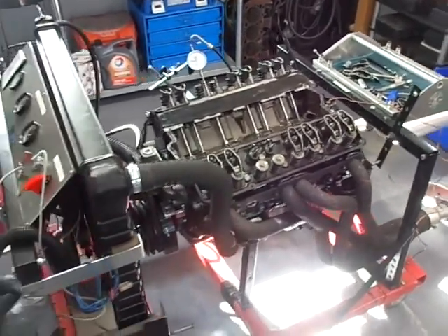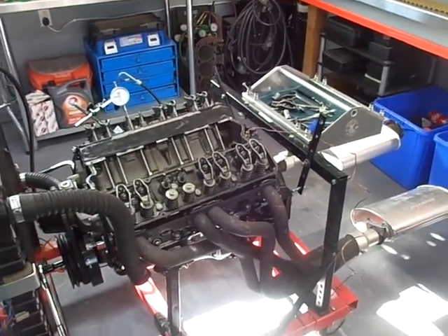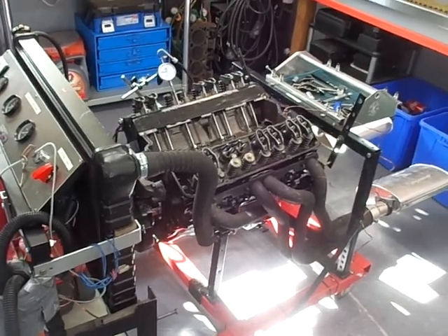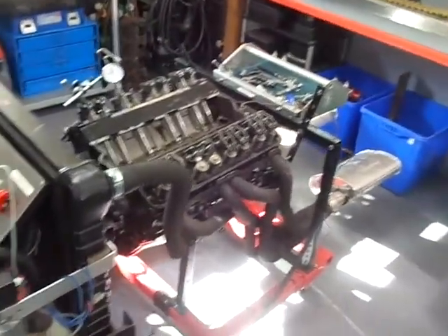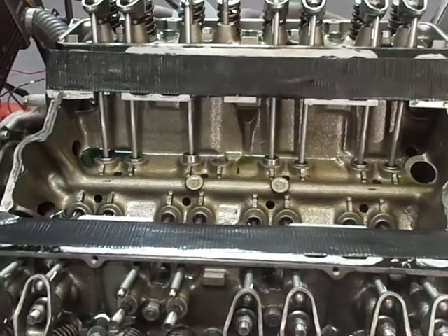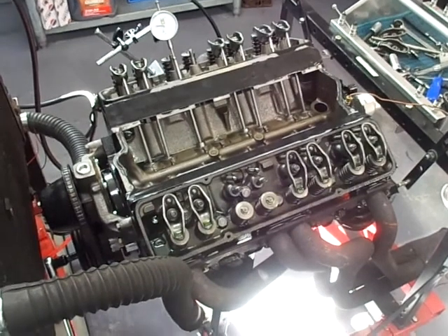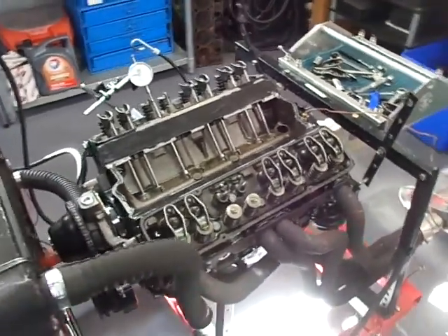Because I was concerned about that, I took special precautions on this startup. I've started up well over a dozen engines on this test stand and never had a failure yet, but we were particularly nervous. I only ran the engine for less than five minutes, shut it down, and did all the diagnostic checks. Going through the timing order — 1, 8, 4, etc. — I only had to get to number four. Looking at it right now, you can see the push rod is out, and the dial indicator on the intake of number four showed that rocker arm had a lot of clearance. My first fear was that the lifter and the camshaft lobe were wiped. However, when I pulled the manifold off — which didn't take very long — the surface looked fine.